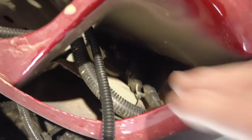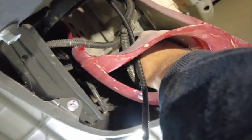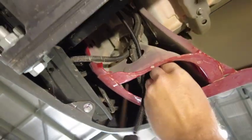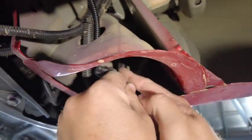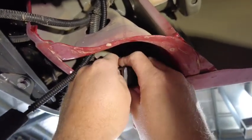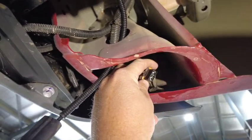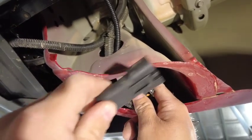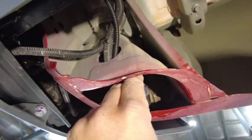In the left-hand rear below the tail light, we need to recover this fuse holder. I'm going to put my hand in there and untape it. We're going to remove the dust cover, remove the fuse, and once we remove the fuse, we're going to connect the black connector in. That's now a watertight fitting.